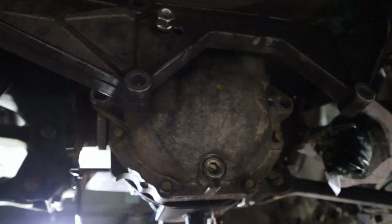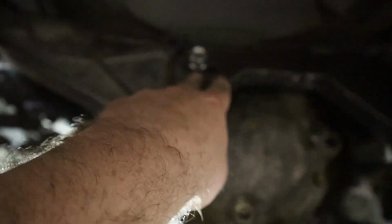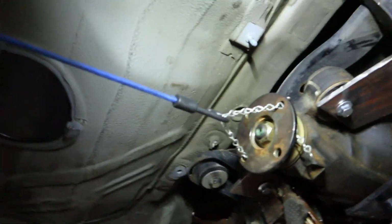In the back, I left the original brace from the old transmission, and then I drilled a hole through the back plate and got it on here like that. We have the original bushings still here, so for the back, that's pretty good, I guess. I got a cord in here going straight through the transmission, kind of middled it out a little bit lower. We have to see where we have to make some room for the drive shaft.